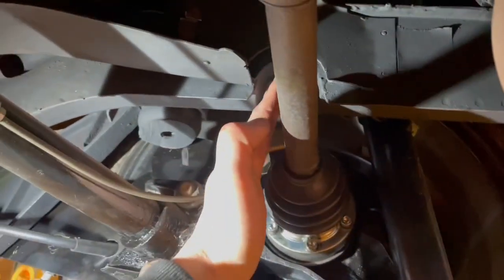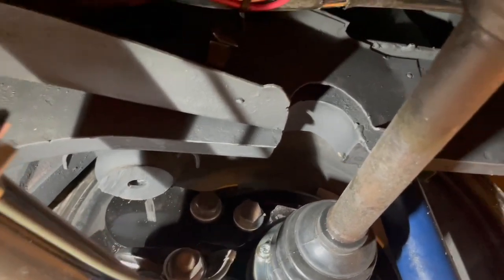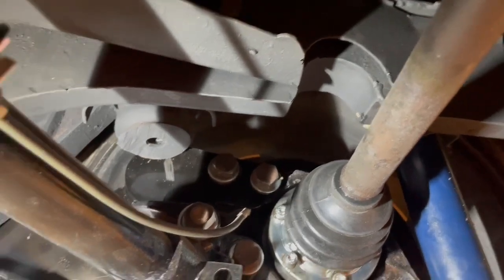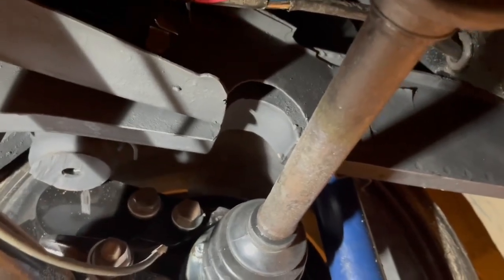I usually do this because when you have some load in it, you have to have a little groove for the axle boot to go through. Normally it would just be flat here but I make a little groove so when the suspension is traveling there's room for the axle not hitting the frame. Some people make a way bigger notch but I do it subtle and this is okay for me.